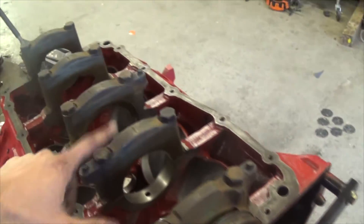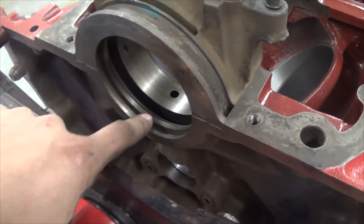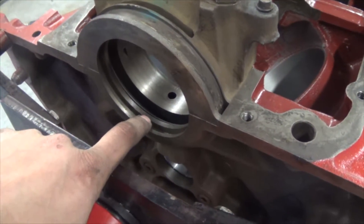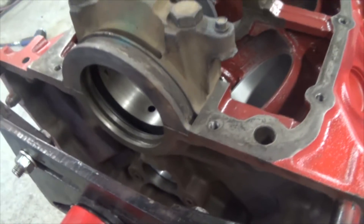Apparently it's a way better setup — why would we be doing it today otherwise? So always a good habit: these are all torqued down to their spec, and that's the way I'm going to store the engine. One thing I don't like about this type of engine is it has a rope seal. Instead of having a normal rear main, it's like a rope that has tar around it. I don't like it, but I'm going to put it back in because that's the way it was stock.